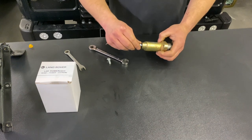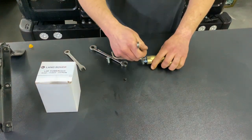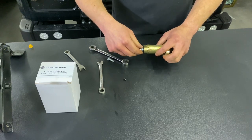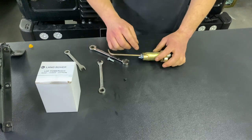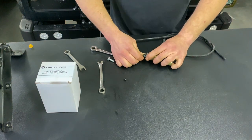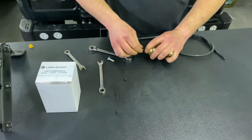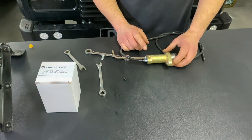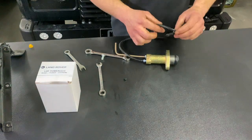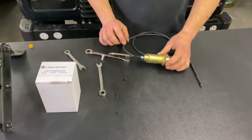Once that's fitted you're going to want to remove the bleed valve dust cover and take the 11 millimeter spanner and loosen the bleed nipple — not taking it all the way out, literally just about one complete turn from tight. Then you want to take your flexible pipe and put it onto the end of the slave, making sure it's a good tight fit so no air can get in. Then go and top the master cylinder up with brake fluid DOT 3 or DOT 4, and pump the pedal a number of times, making sure the other end of the pipe is in a suitable jar or bucket.